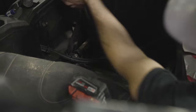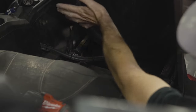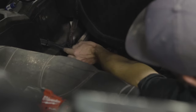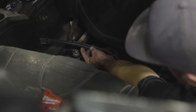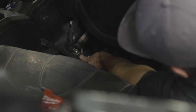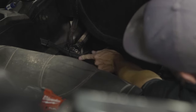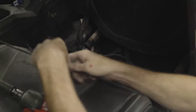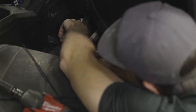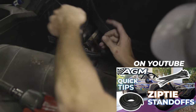Now just continue the install in the reverse order that we took things out — putting both seat nuts back in. Before we move on, this is where we're going to zip-tie everything in place. If you don't move your seats forward and back and they stay in one position at all times, secure the hoses so you have a continuous upward angle. If you run your seat in multiple different positions, you're going to want to move these down and zip-tie them to the uprights or the rear studs at the seat so when the seat is being moved back and forth it doesn't contact either of these hoses. This particular customer gives a lot of rides, so we're securing this in the lower position using a zip-tie standoff — we have another video that covers that specifically if you have questions. Always cut the extra leads off the zip-ties installed.